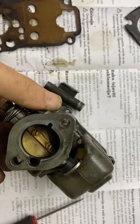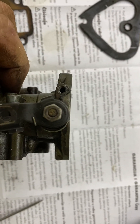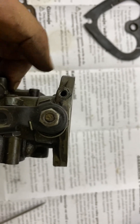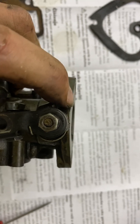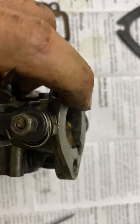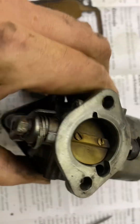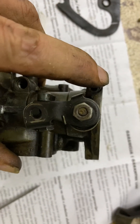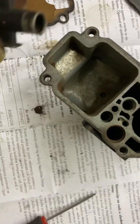The bottom of the carburetor has a slight warp — I'm not sure if you can see it, but this part is a little higher than the other sides. This could be sanded out with sandpaper, but I'm not sure what I'm going to do. So we've got a warped carburetor — that could be sanded. The next issue is this venturi.